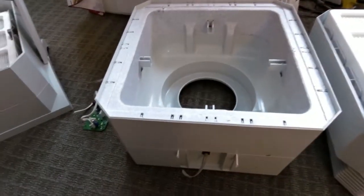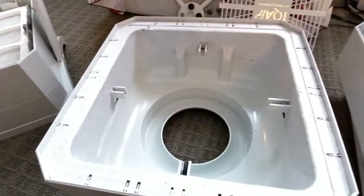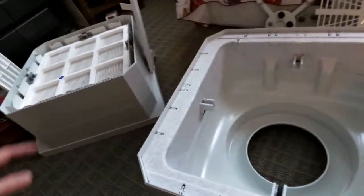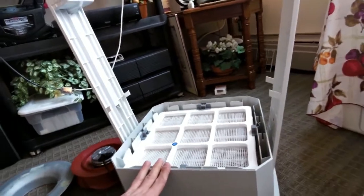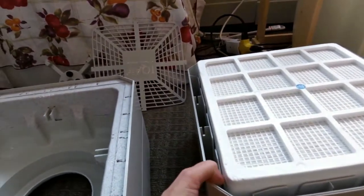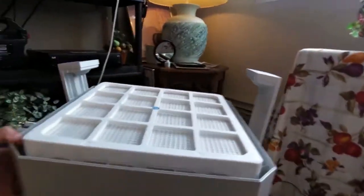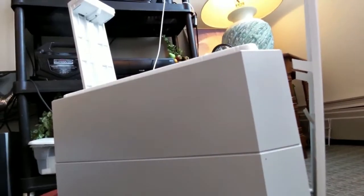We're going to put this together but with some changes. The original design was pushing air through the filter, which is good for eliminating particles, but the new way we're going to be pulling the air through both filters at the same time. We'll leave the bottom assembly intact as it always was, and instead of the fan assembly being in the center, we're going to put the HEPA filter in the center. It was normally on top, but now it'll sit right on top pulling air through both.